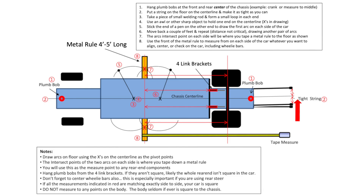Also, if you're intentionally going to add rear steer into your car, the reason we want you to extend that string beyond the wheelie bars is you need to go back and make sure the wheelie bars are re-centered on the chassis. You do not want a rear end with rear steer and wheelie bars that are no longer square. If those wheelie bar wheels are touching the track on the hit and you have not re-centered the wheelie bars after adding rear steer, that will influence whether your car goes left or right — hands down. I have videos on rear steer and on wheelie bars. It's all about the combination of everything working together — these pieces have to be in balance to make sure your car goes straight.